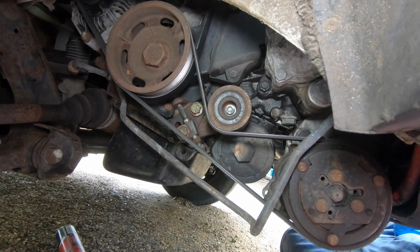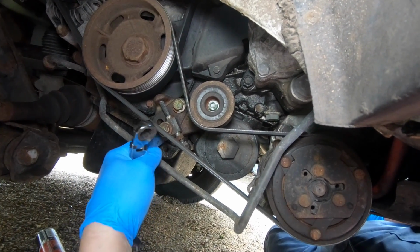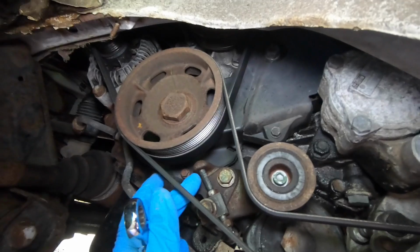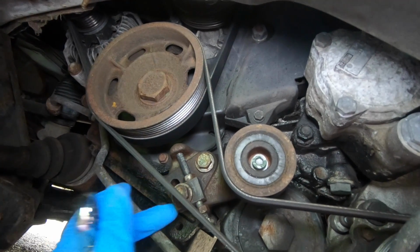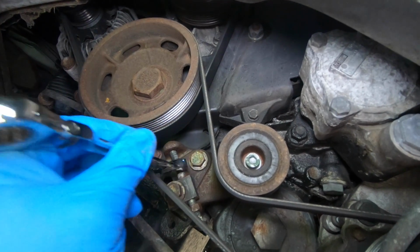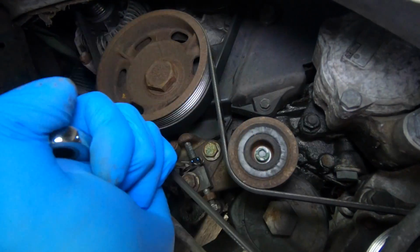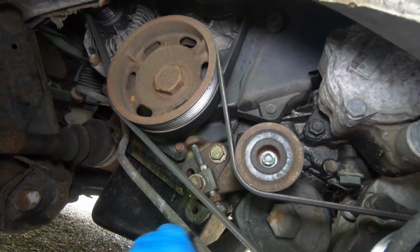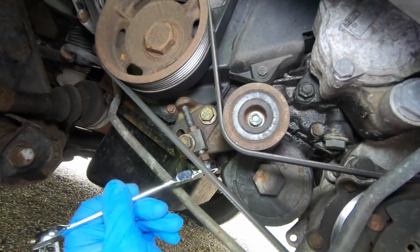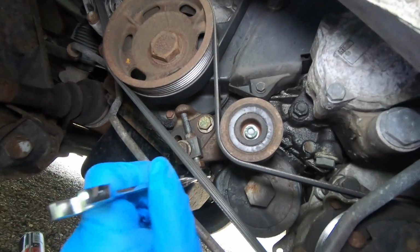So you loosen up the two bolts in there now. I'll loosen this one just because it goes into here, so it must pivot on this one. As you're screwing that in, it's putting pressure on. It's coming through this block here and pushing against that tab there. And there's a lock nut top and bottom. So when we wind this in, we'll wind this one down and this one up to lock it in place. But you never want to over tighten because you've got bearings in the auxiliaries, like there's bearings in this air conditioning pump.